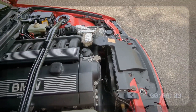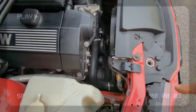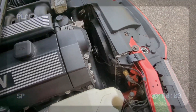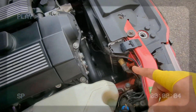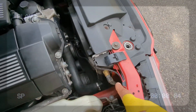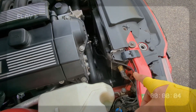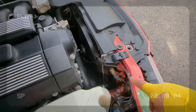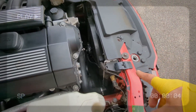The first option: if you have AC, which this car has, you can delete the clutch fan and just run it without one, then use the normal temperature switch for the AC fan and put in a switch with a lower setting. This is a two-stage switch - high and high-high. If you switch to a lower one, let's say 80 degrees for stage one and 88 degrees for stage two high speed, then it's not necessary to have a fan up front at all.